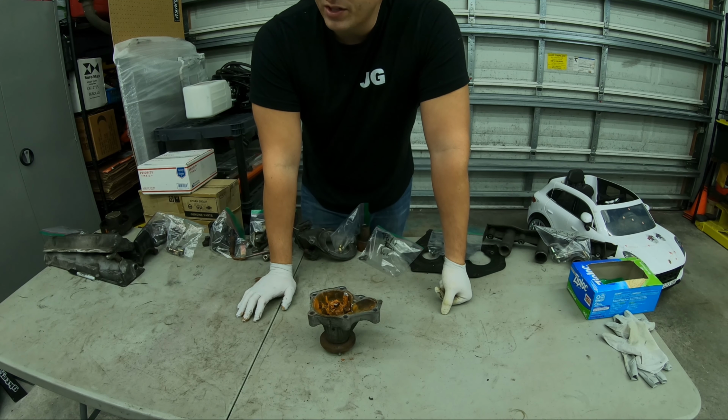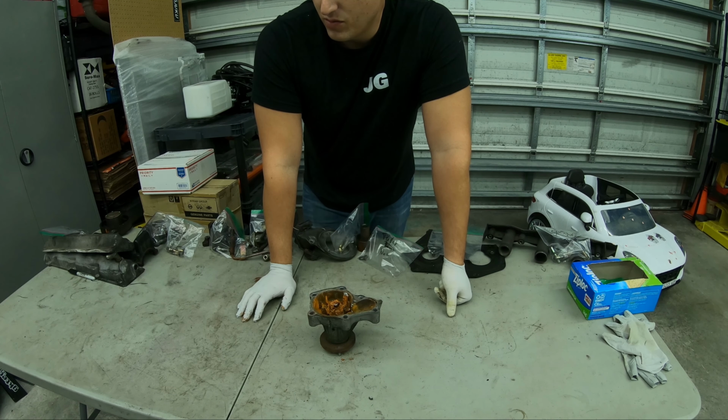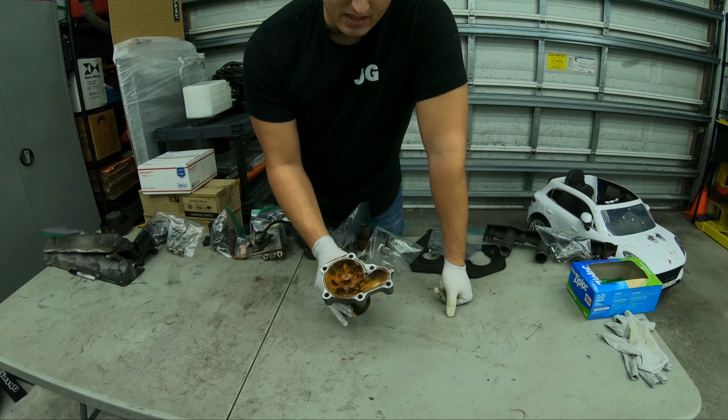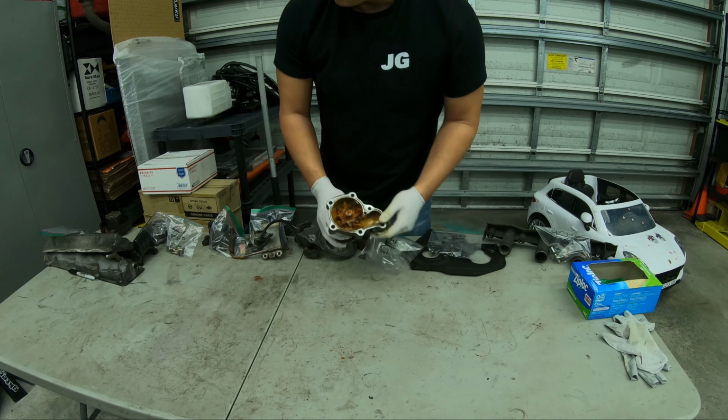And then if you do have to go to the track and you can't run antifreeze, because I totally know that that's a thing, there's something called Water Wetter. Put that additive in your water and then use distilled water as well. Keep your system from looking like this, and then just run antifreeze when you can to keep the rust out.